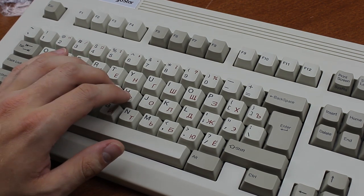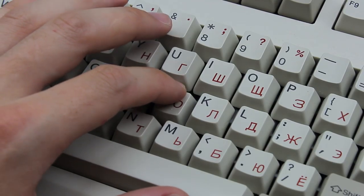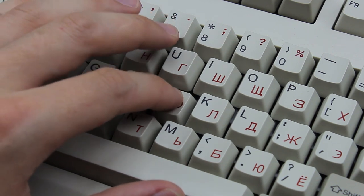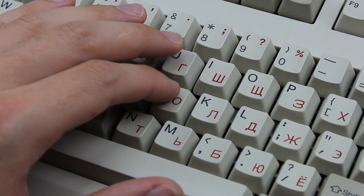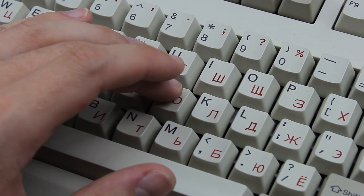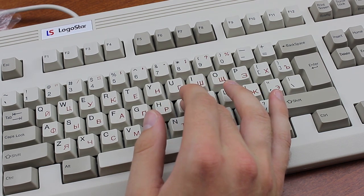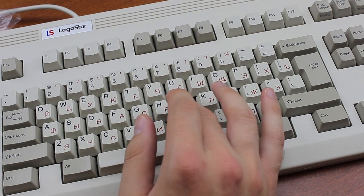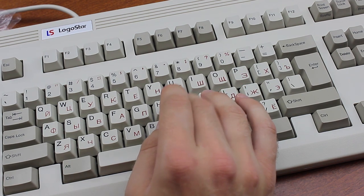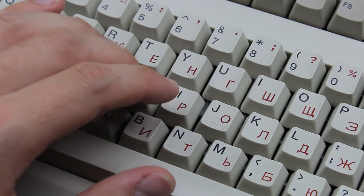It's really difficult to describe exactly what it is that makes this keyboard feel like such a nameless, unutterable rampart of perdition. Touch typing Christ on a KB101A — it's bleeding awful, just get it away from me. The key feel is unnaturally short; I'm not sure the travel actually is any shorter than other keyboards, but the bottom-out feel is so spongy, scratchy, and resistive that it instills an almost claustrophobic sense into the user. If I had to come up with one word to describe the bottom-out feel, I'd go with inaccessible or granity. The click is solid — that's the one part they managed to get down well — and the tactility is definitely there, but it's really rough and kind of bulky, and feels almost like an afterthought. The click even feels somehow disconnected from the key feel; it's absolutely bizarre. Lovecraft would probably have described it as non-Euclidean. And on top of that, it's too stiff, super scratchy, and it binds pretty badly as well.